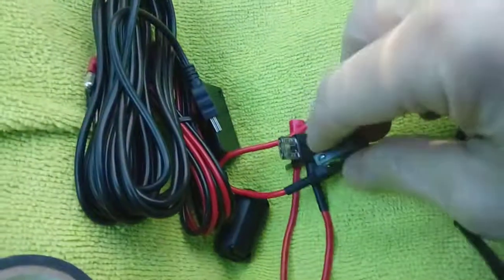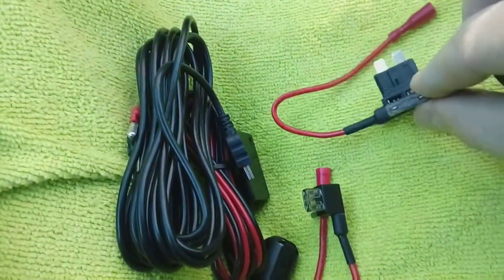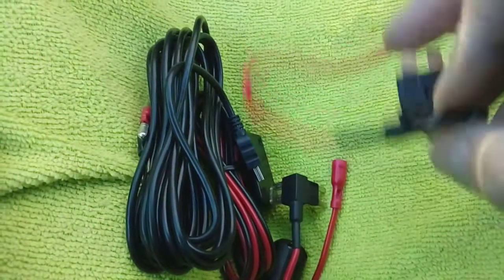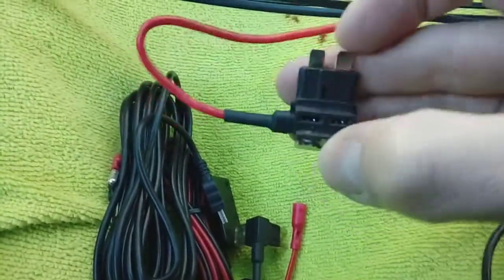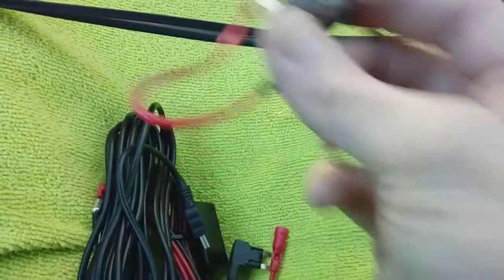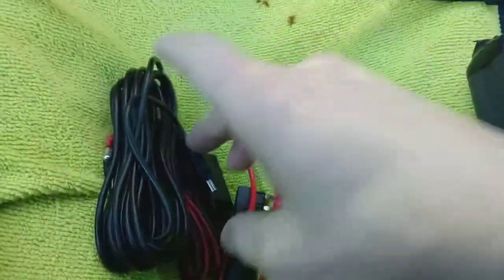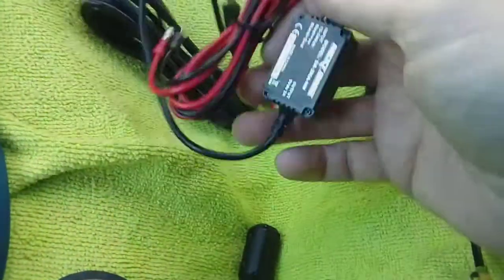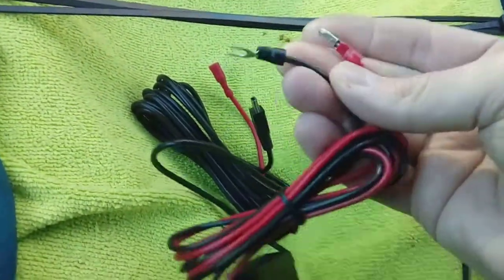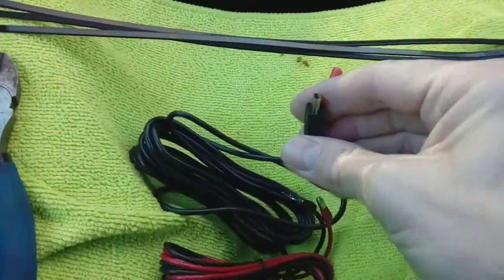To do this job you'll need a fitting kit, which you can buy off Amazon or eBay. A camera fitting kit normally comes with two different size fuse spurs — for big fuses and mini blade fuses. You'll notice there's a gap next to the fuse for the camera; that gap takes the fuse you remove from your fuse box, which you then pop back in to provide a live power source. The pack also includes a power cable with red and black wires — red is power, black is earth — and a standard mini USB on the other end to connect to most cameras.